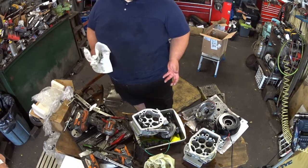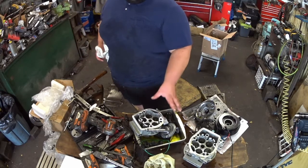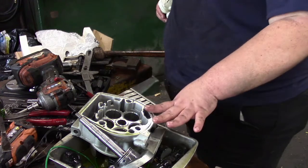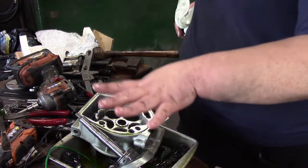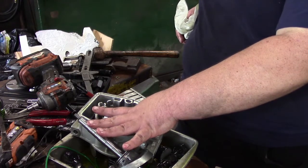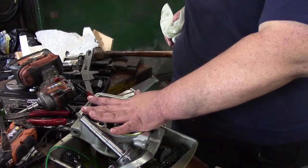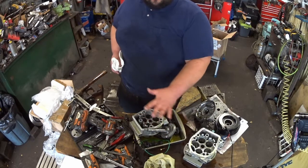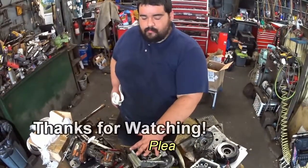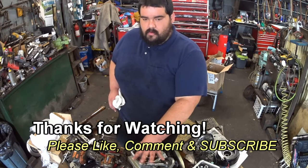Now we have more testing that needs to be done once we go back to the vehicle. We know why this compressor failed — most likely because of an external source causing high compressor temperature. We can go back to the vehicle and check: did we have a charge issue? Remember, we depend on oil flowing through the system and cold refrigerant coming back from the evaporator core to moderate compressor temperature. We can bring this system up to spec and see if we have a charge issue or something that was overheating this compressor.